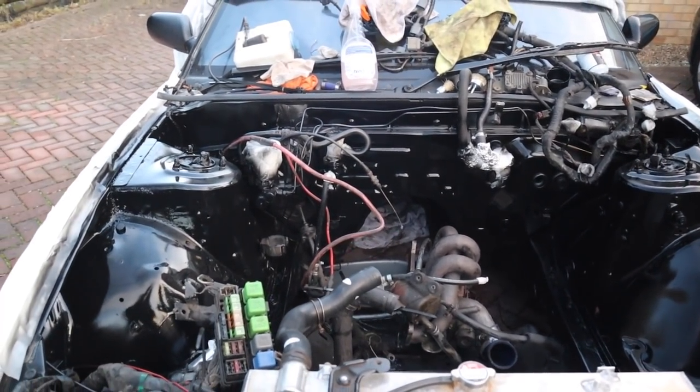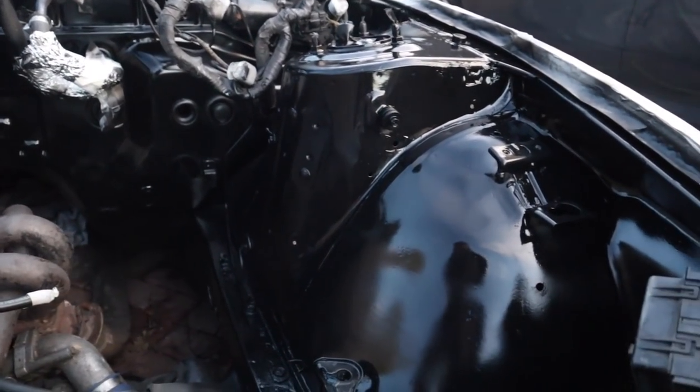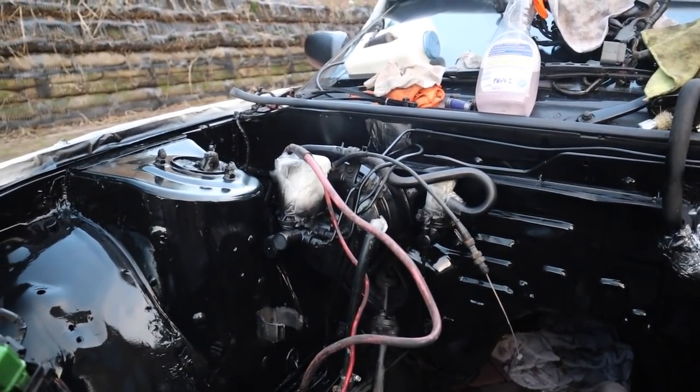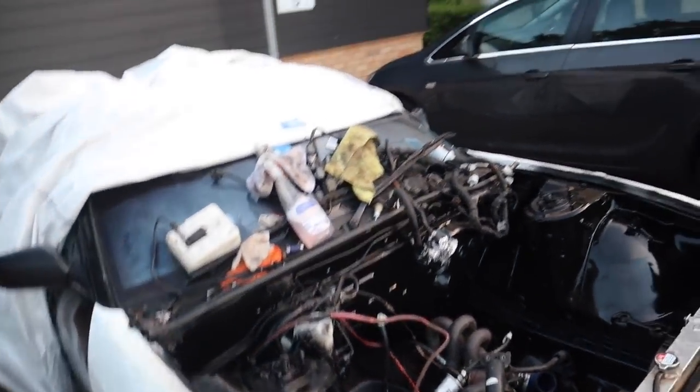Right, and that is two cans. It looks so much better. That prep was an absolute pain and yes I probably didn't do it perfectly, but is it miles better than it was? A hundred percent. It's protected now. Looking back I actually didn't do that bad of a job grinding it down. The rust converter — I don't know how well it worked, it never dried properly. If I did it again I'd probably use a heavy-duty primer. But I'm glad we got a tough industrial paint because that's going to do a great job protecting it.